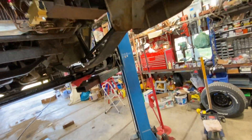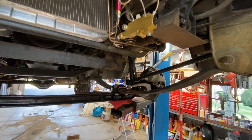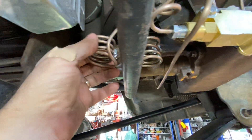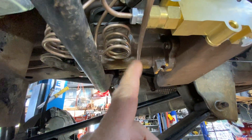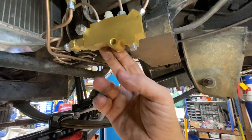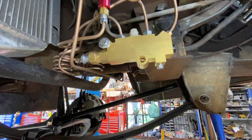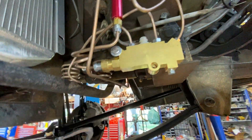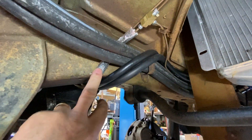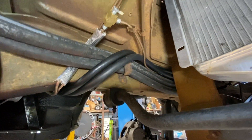So I'm going to turn the camera around. We replaced the master cylinder and all the brake lines. We like the way this turned out — those little tubes. I could have probably spun them the other way, but we'll do that another time. Also, on this proportioning valve, we bent this bracket back — it was normally out like this, so we heated up that bracket and bent it back. Then you've got your residual pressure valves, and we also ran these over here and put a little bit of insulating material on these brake lines because they do come a little bit close to the heater hoses. It shouldn't be too big of an issue, but we didn't want to take a chance.